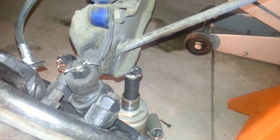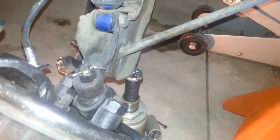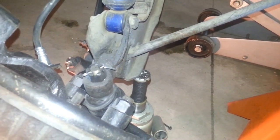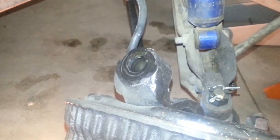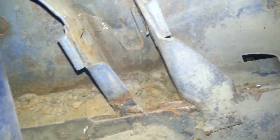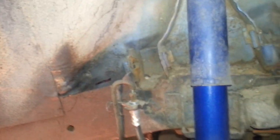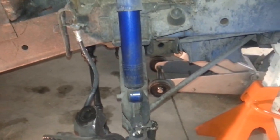Now doing a little reassembly. I'm using a little bottle jack to get the lower control arm jacked up so I can get the ball joint in easier at the top — you need to jack that up because you're working against the shock. I'm also getting all that lovely debris scraped and cleaned out before reassembly. We're eventually going to yank the fenders and do more work, maybe put it on a rotisserie and do the whole thing, but right now just trying to get it drivable and looking good for my son's shows.